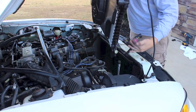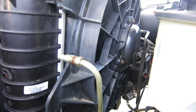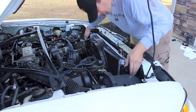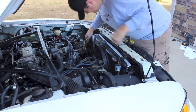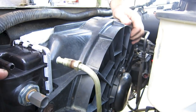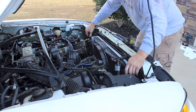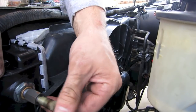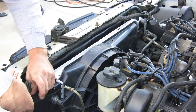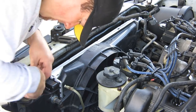Let's put the new radiator in. Make sure the wires and transmission lines are out of the way — you don't want to mess those up. Make sure everything is going in how it should go in. Put the bottom of the radiator into the rubber bushings at the very bottom and make sure everything is lined up — just wiggle it until it finally goes in. Check to make sure nothing is being pinched or squeezed, then test the transmission cooler line to see if it fits at a good height. Take your radiator bracket with the bushing and put the bolts in.